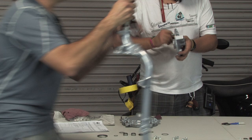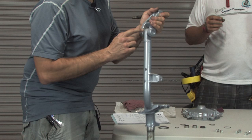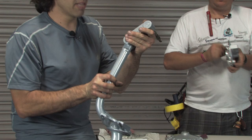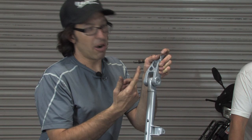For the fork, the whole shaft has been masked with the lower bearing race, and the axle's been masked off. One trick we did here: I didn't actually remove the needle bearings — this thing's in perfect shape, still rolls really good on the pivot. Generally these needle bearings last quite a long time; maybe if it's exposed to water and rusted up you may need to rebuild that. It's actually pretty tricky — you need to pry these out and use a hydraulic press to rebuild this little assembly. We have the whole kit, though I don't have the part number offhand.